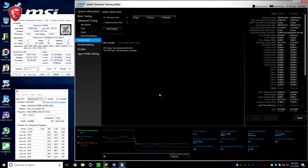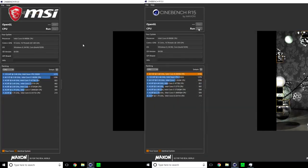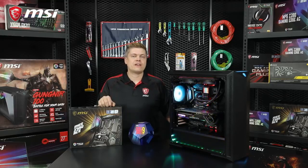Next on the list is stability testing. We can use CPU-Z to check the CPU frequency. To check CPU temperatures and power, we can use CoreTemp or HWiNFO64. For a live graph readout of your Intel CPU, Intel has their own excellent Extreme Tuning Utility, which has a stress test as well as indicators for thermal and voltage throttling. Our first test will be running Cinebench R15 for a primary stability test. In our testing, the 9900K went from 2,009 points at stock to 2,167 points at 5 GHz — that's an increase of over 158 points, or an 8% gain, which is pretty darn impressive. For a torture stability test, Prime95 version 27.9 or higher will test AVX instructions; half an hour is a good quick test, whereas if it can survive 2 hours, your system is completely stable. If you don't want to push it to the max, a test with version 26.6, non-AVX, will be fine too.